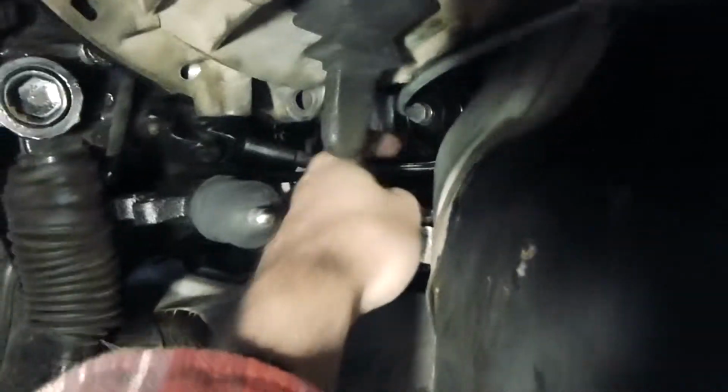And the only thing I needed to change underneath that was interfering with the gearbox was the fuel lines. So the way I had wrapped the fuel filter, it was quite far out, so I've taken that bracket off and I'll remake a bracket and tuck this up higher. So if you can just see that. So normally the fuel filter on an 86 sits way up in the front there, but I don't like that look, so opted to put it there, a little bit in the way. But once I reroute that, then it should be sweet.